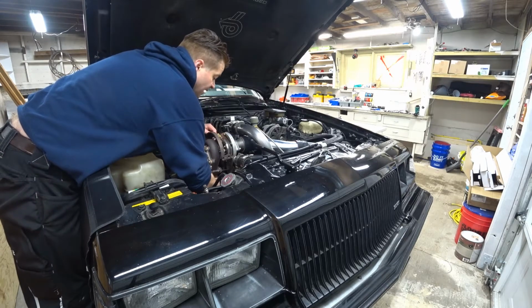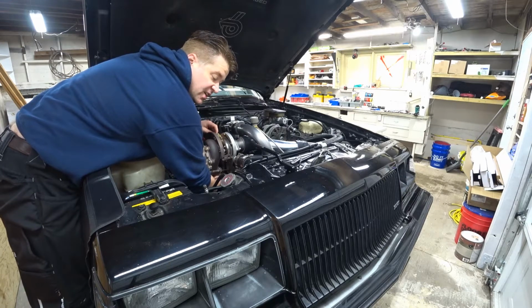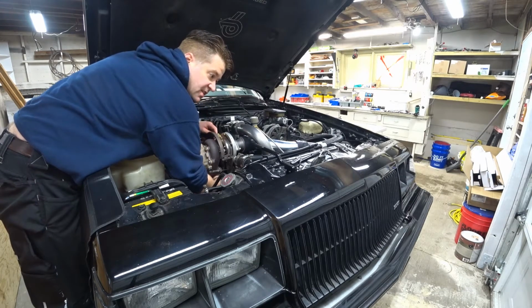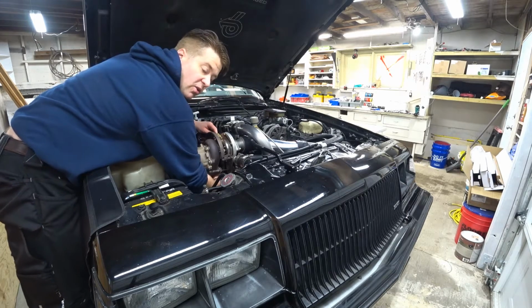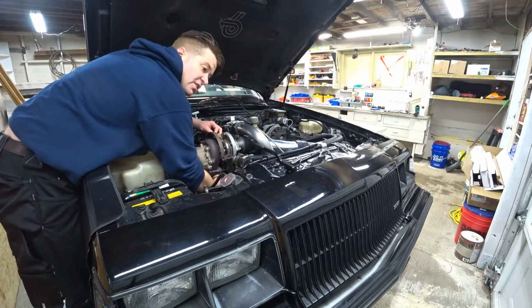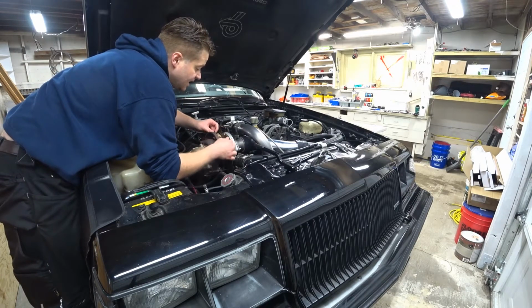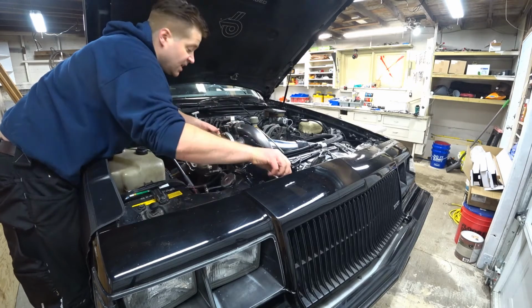Right now I'm just making minor tweaks. I noticed it was touching the oxygen sensor down here, and there's no sense having it touch that and translate some of the heat from the exhaust into this thing and have it vibrate and touch and eventually wear a hole in the oil line. So make sure it's free of all obstacles. I feel along the line as I'm going, and then as I come back I'm going to check this thing, and you know, that's looking really good. So I'm going to make a mark.